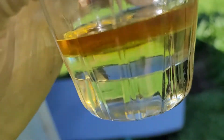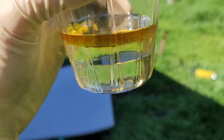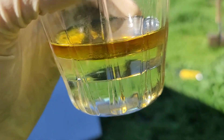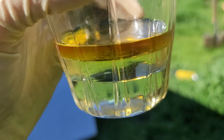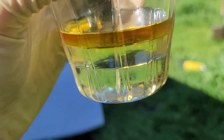So basically if you're going to flush it out of your vehicle and you want to run DOT 4 instead of DOT 5, or vice versa, it's actually going to be easier to flush the DOT 5 out because the bleeder is on the top. If you're going to upgrade to DOT 5, or switch to DOT 5 from DOT 3 or DOT 4, you're going to have to flip the caliper upside down so you can get all the DOT 4 out.